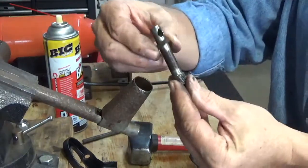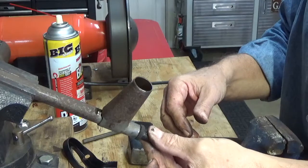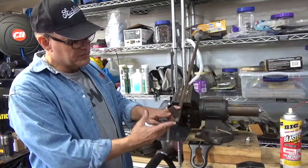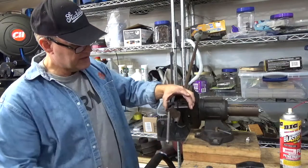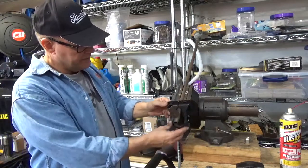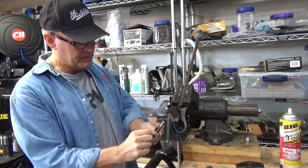This is kind of a soft metal, and even with slight tapping I still put dents in the end of this pin, so be careful — don't get in too big of a hurry and end up breaking it. But there's the pin, and there's that felt washer that pops out. I just took some fine emery cloth, cleaned both the inside and outside, and now I got that moving back and forth. Once I was able to get that pin out, I could slide it over and you can see it goes inside of there — a lesson learned, but also valuable in understanding that this needed to be moving freely.